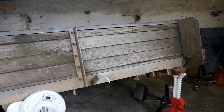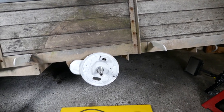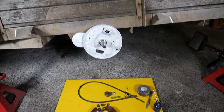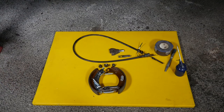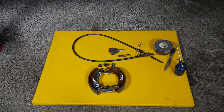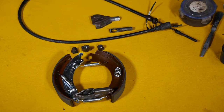This is the back of the trailer, so I'm working on the left hand side. Note the position of the slipper shoe — as that drum goes backwards that spring will stretch and release the brake. Let's crack on by installing the left hand brakes.